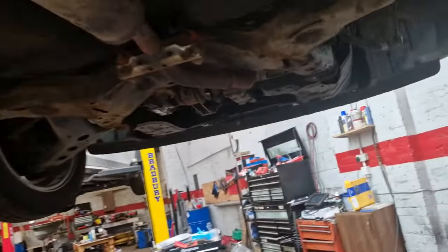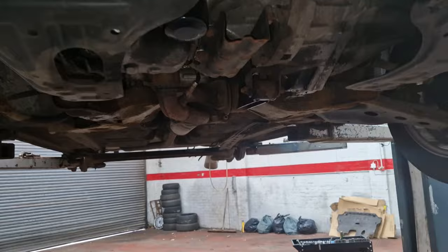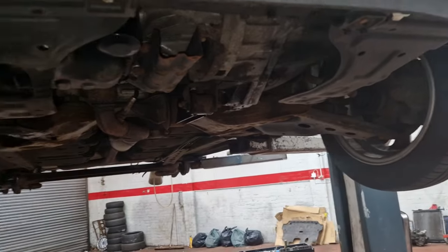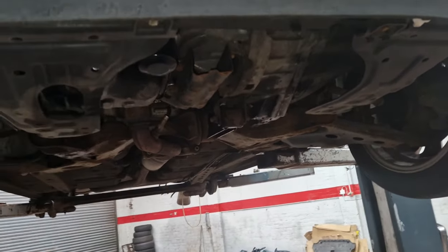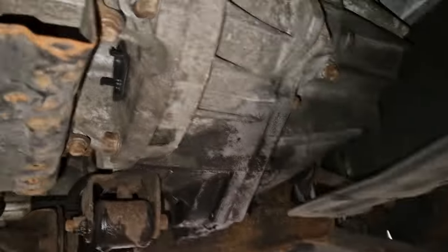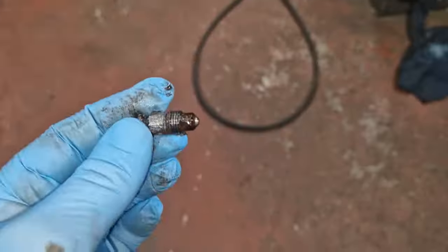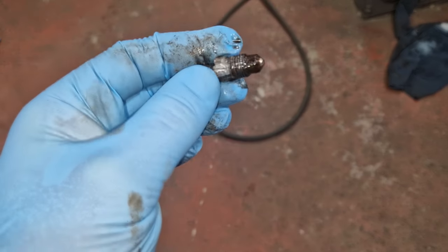We're going to elect to change them right back to here — there's no point in messing about. It's rotting there, we could cut them up somewhere, but it's rotting there so no point. I would imagine it's rotting somewhere else as well. The front's not too bad. Obviously you can see it's had ATF in it — it's not meant to have ATF in it, it'll not do any harm to be honest with you. If you came into the dealership and the customer was complaining of poor gear changes, that would be my first protocol — change the gearbox oil and change it to ATF, either 50-50 or just all ATF. BMW used ATF back in the gearboxes back in the day. We've got the pads and discs to do as well, but we'll need to crack on with these brake pipes.